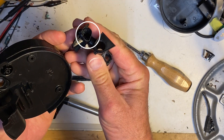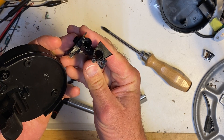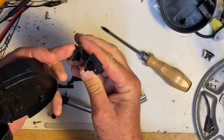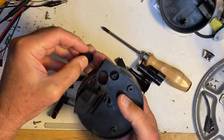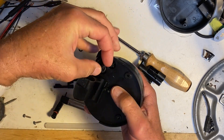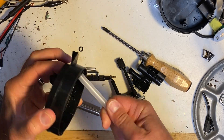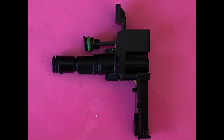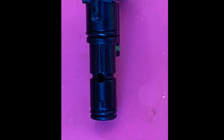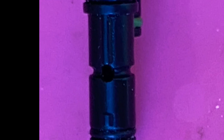I found this kind of interesting. This is the back side of that cleaning port and it's really badly damaged. I think steam was blowing back and eventually just deteriorating the plastic. And then one last piece — this is that rubber grommet I was talking about, this is what seals to the straw. Here's that port that I mentioned earlier, and you can see here this is the hole that's on the bottom, and that's what provides the path for the suction for the milk and for the air.